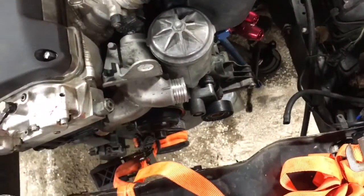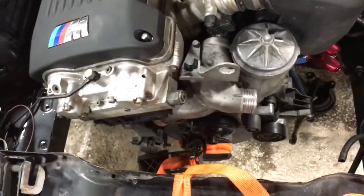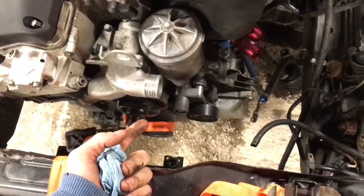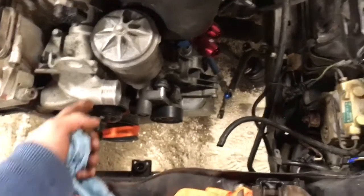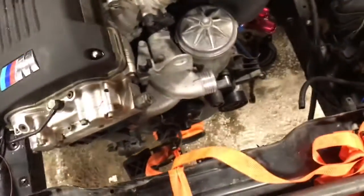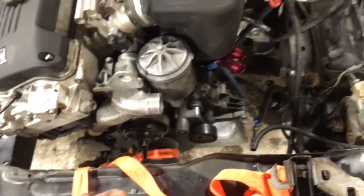You don't need any special hoses like you do with an M54 - just anything you'd normally use on a swap. Generally just run E36 hoses. For the upper, I go with a 1976 Ford Econoline radiator hose, which works really well because it's a generic 90-degree bender hose that's good and thick, takes a lot of punishment, and you can cut it down to size. But again, E36 hoses fit pretty well.